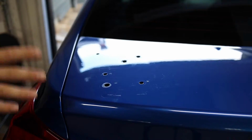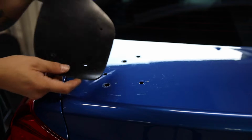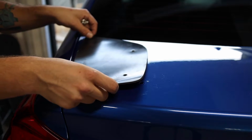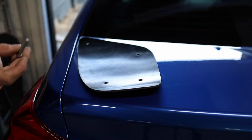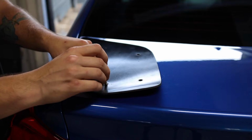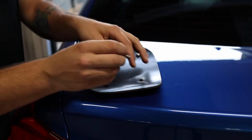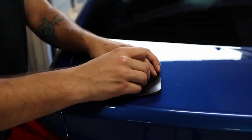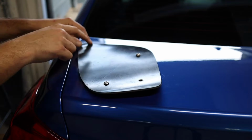Alright, so I knew I was going to have to drill holes, but I finally figured out where. The base plate mounting bracket is going to end up sitting like so. What I've been doing is taking the 40mm screws that come provided with the kit, pushing them down into the holes, and then drilling my holes. The 2 that we need to drill are this back right one and this top left one.